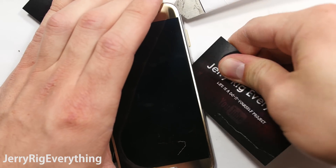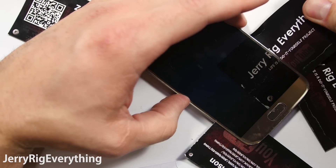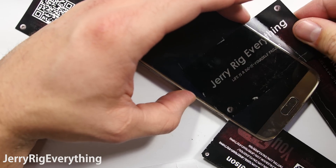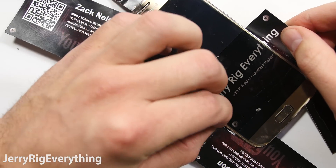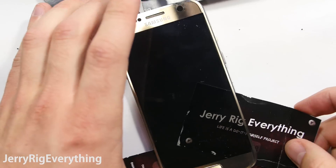That's why I say that nothing is salvageable when you are removing the screen from your device, and a charging port repair is most likely going to require a screen repair as well. The glass and polarizer are not glued to the AMOLED screen. Normally, like with the Note 5 and other Samsung phones, everything is glued together so it's more structurally sound — this screen is not.